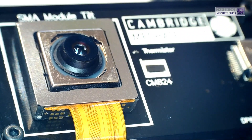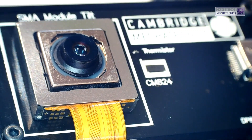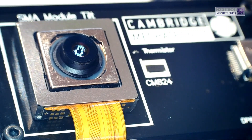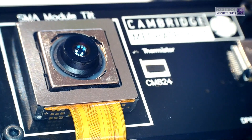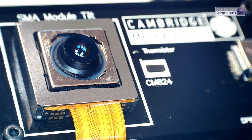The Module Tilt OIS actuator is based on our existing and proven 8-wire technology and currently provides OIS suppression of up to 3 degrees, enabling great quality video whilst walking and even running. Module Tilt OIS is different to lens shift and sensor shift because it steadies the entire camera module. Both lens shift and sensor shift can provide great suppression of the centre of the image but still show slight blur in the corners, whereas Module Tilt provides great suppression across all of the image.